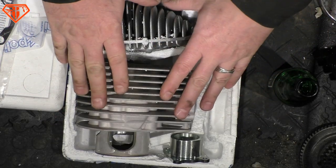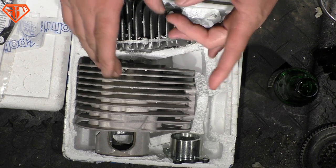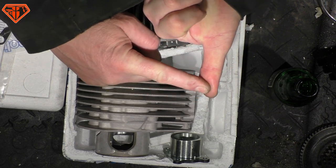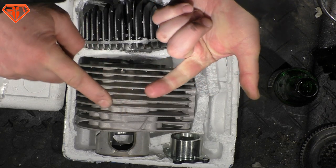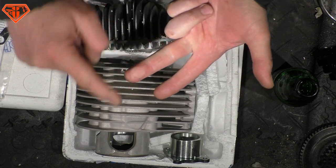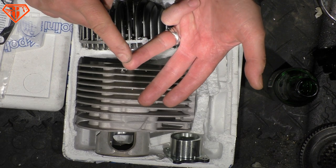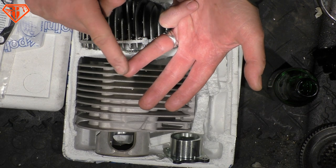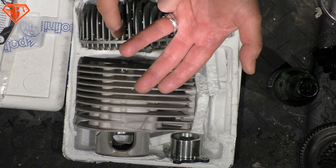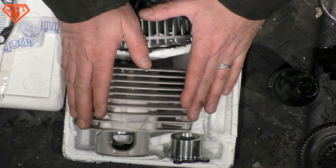Conclusion. Nice update, finally. A piston is sold, state of the art, which does not crumble, yes, but old port layout from the 80s, low power. Seal ring missing at the head. Seal ring missing at the exhaust nozzle. Piston is good now, but it has thick rings. It has 1.5 millimeter rings. Malossi has 1 millimeter, and the Grossport piston also has 1 millimeter. Piston is heavier. Overall, it's not a recommendation.